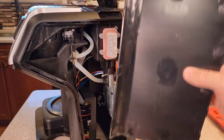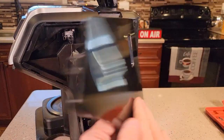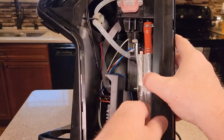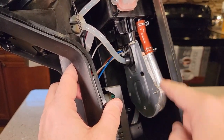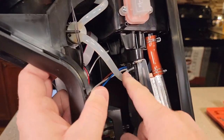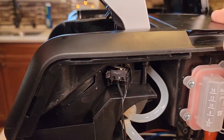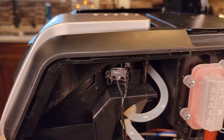Here's what that side panel looks like off. You've got to be able to get to these two screws and then this panel will pop off. Once we've got that side panel off we can see in here — this is where the water goes for the K-cup side to get heated. It could be one of these tubes that have come off, or it could be this tube or these tubes right here. There is also a micro switch; if your machine is not working, it has to see that the door is closed and then that micro switch makes contact.